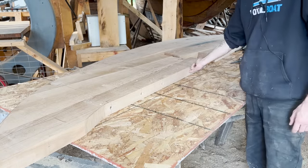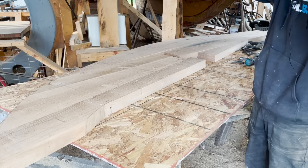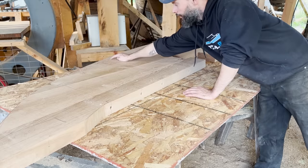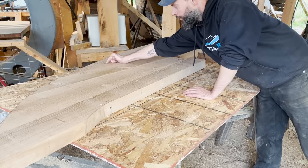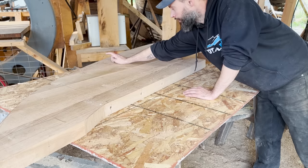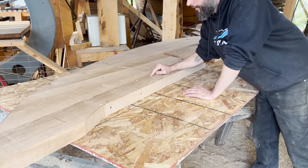First round of holes. They need to become a bit bigger. They're half inch now. We'll bore them out to 5/8. Now this is a tricky bit of drilling. This side of the rudder here is going to get shaped down to only 5/8. So we actually need to terminate these bolts in this outer piece. We can't go to the edge. We can't bring a 5/8 rod all the way up to the edge. And we need to make sure that these all stay flat and aligned.